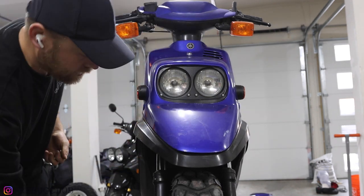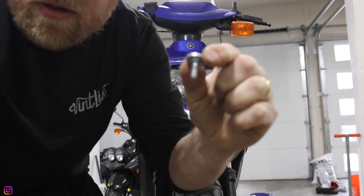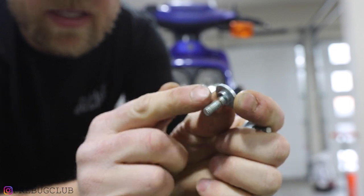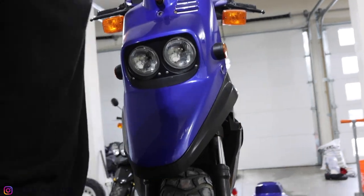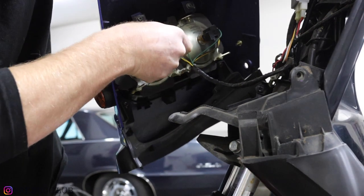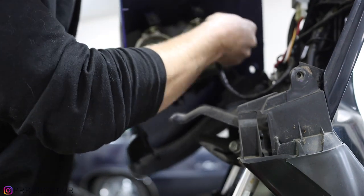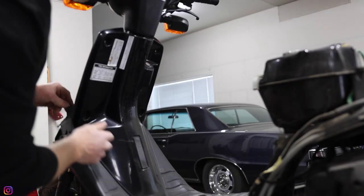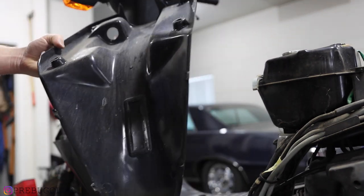These bolts — there are three of them, and they're all the exact same. They're a little bit longer with a thick stepped washer that sits inside the fairing. On the side, you can pull the little nose mustache fairing out, and then the headlight. These can be kind of rusty, so just give them a little wiggle. Hood off — two tabs on that side, and these little things can grab, so you have to be a little careful, especially when things are brittle.